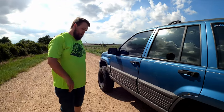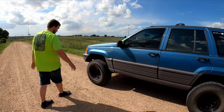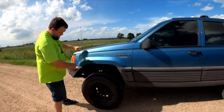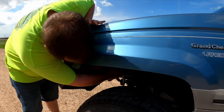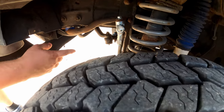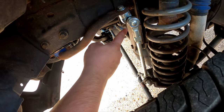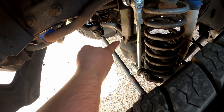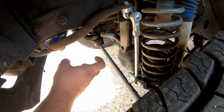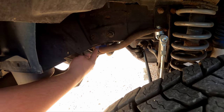Like I said, this one's got a front to rear spring swap. Got Rough Country springs up here. I wouldn't go Rough Country again. They're awfully rough. And then we've got some upgrades. The double shear track bar that I talked about in our last video. That's what it looks like. It's a drop bracket with eyelets on each side to put bolts through. That's a stronger setup to upgrade from.